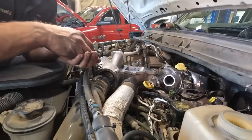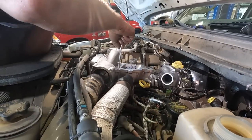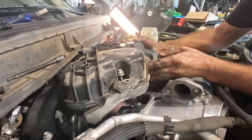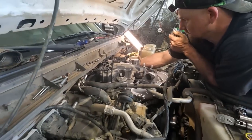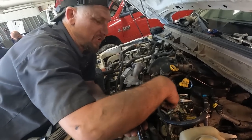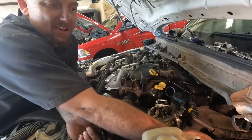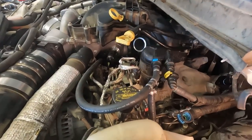Bolts back in, and we'll have to get the throttle blade off of the other intake and put it over here. All that free stuff is just getting covered up by ugly plastic - 100%, sad isn't it. This line would be here originally like this, and you pull it off. The line coming from where we put on the FCA or the volume control valve - you put this T in, it hooks here and here and then goes back like factory. Then you take the return line - it goes back to the tank - and this will just twist inside there. If it won't twist, take a heat gun or lighter and heat the plastic and it'll twist right up for you. Then take this bolt off and put it all together and show how to mount it and put the rest of the lines up.